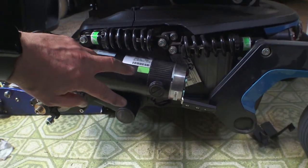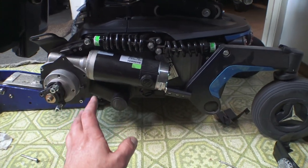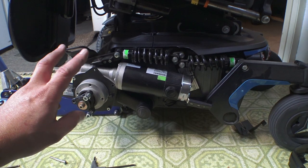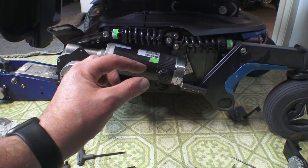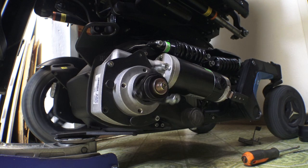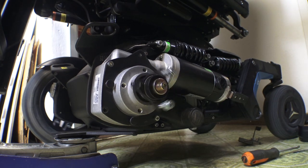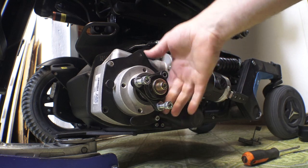It's not going to hurt anything but it takes like 50 miles or more before those seat in. Coincidentally, that's what's going on when motors are breaking in — brand new brushes slowly wearing into the commutator, getting the slightly round curve, seating in properly. Motor break-in is all about the brushes. Okay, let's fire it up. Sounds like we're good. It may sound a little different under load, but basically that's a brush service on one of these. Kind of interesting with all the plastics on here to take it apart, but at its core it's still all the same components Permobil's been using pretty much forever — they just redesigned the plastics and added some velcro.